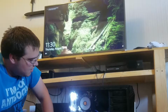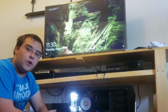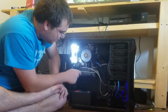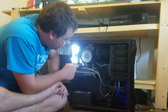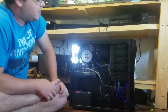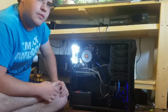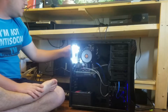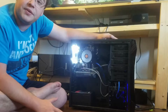for obvious reasons. So just to run down the specs again, we got an i5 2400 processor. We've got ourselves a GTX 1050 Ti graphics card, an H61 motherboard, a terabyte hard drive, and 120 gigabyte SSD. So a pretty decent little build. And did I also say RAM? We got 16 gigs of RAM as well. So this is a decent starting build. I hope my brother will find some good times out of it.